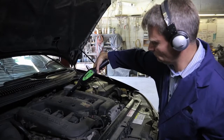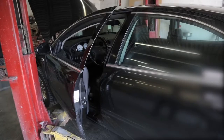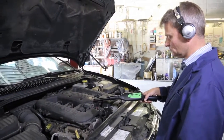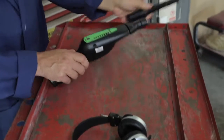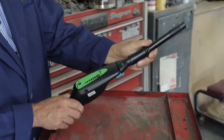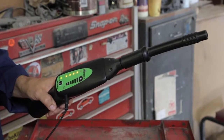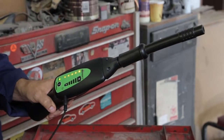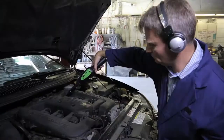The unit will now produce a natural sound that you would expect to hear from a leak or component defect. This vehicle came in with a rough idle complaint and a lean exhaust trouble code — a vacuum leak is a good possibility, but from where? Begin by attaching the air probe to the nose piece, plug the headphone jack into the receiver, put on the headphones, turn the receiver on, adjust the volume, and scan for leaks. This engine has a blown intake gasket.